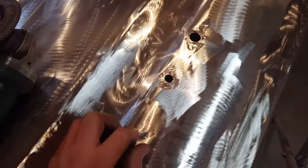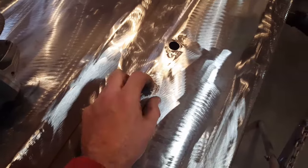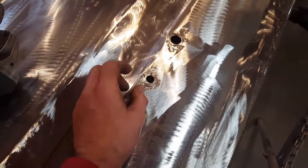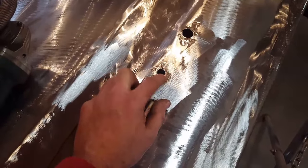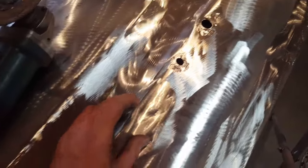And the key to doing any holes like this is usually a lot of these, the bolt gets pulled through. Take a die grinder to it. Just make a bigger hole if you got to. Don't worry about making a bigger hole. You can make a bigger patch to put in there. It's just that if it's very thin along this edge, you're going to have a hard time trying to weld to it. So make it solid and you can weld it in.